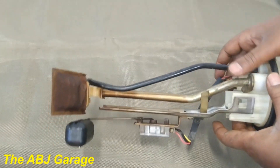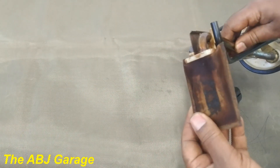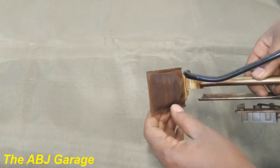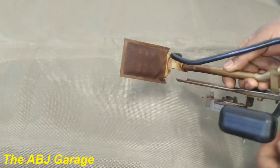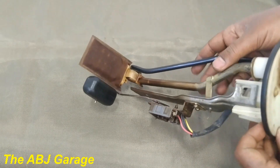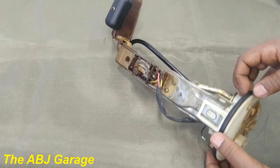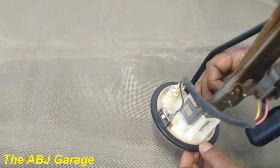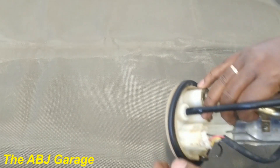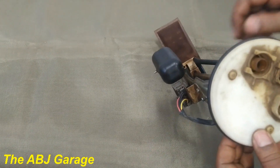The remaining step is a visual inspection of the component parts. Make sure the strainer is not damaged or blocked due to excessive foreign material or dirt accumulation — make sure it is clean and undamaged. Also make sure the gasket has no breaks or damage to ensure a proper seal.